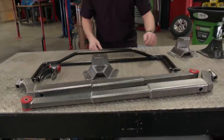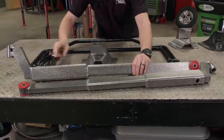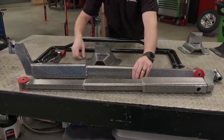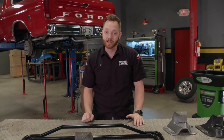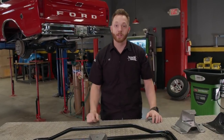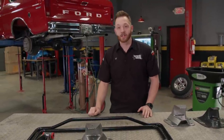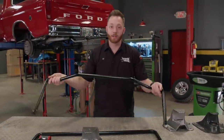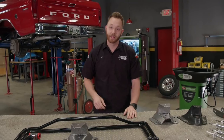Out front, it's actually quite easy to lower one of these trucks. All we're going to be doing is bolting on one of these dropped I-beams — we can still use our stock coil springs, radius arms, and hubs. Lowering the center of gravity of this truck will definitely improve its handling, and all these parts together would be considered a 3-4 inch drop. But we still won't do anything to fix all that body roll, so we also picked up a sway bar kit for the front and rear, which will let us really push the truck hard into the corners for nice flat handling.